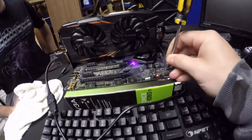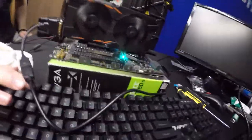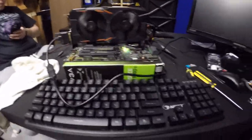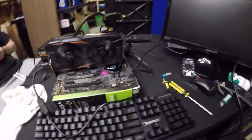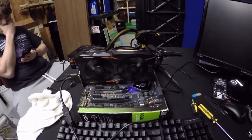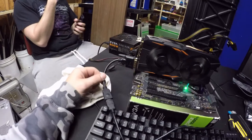Turn it on — keyboard lights up, but that's all it does. Everything else is lit, it's coming on, but it's like we don't even have the HDMI plugged in. According to Reddit there are about a thousand other people dealing with this same issue. It's the motherboard causing this — we need to figure out why everything works but it won't talk right. We'll try going back to HDMI real quick.